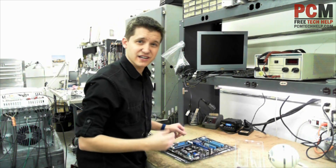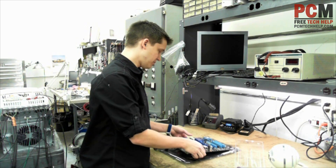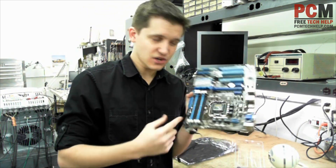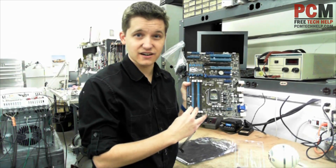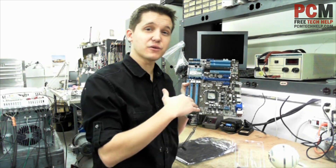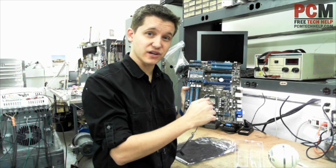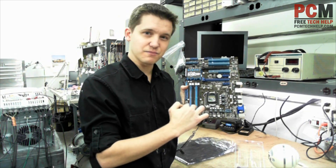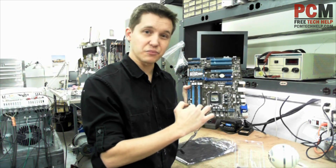If you follow along with these videos over the next couple weeks, we're going to be doing a lot of videos like this. I'll go ahead and pick up my motherboard here, and you'll see that the actual memory slots are color-coded. Since these came as a dual channel kit — two memory sticks of the exact same size and speed — they're designed to fit into the color-coded slots. The best practice is to install memory in the slots closest to the actual processor, as that allows for faster bandwidth transfers. Make sure you're following the color-code scheme; even though they're not right next to each other, they're meant to work in parallel.